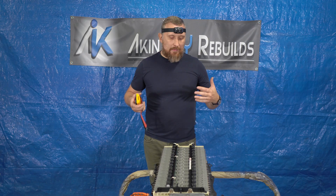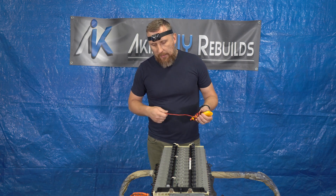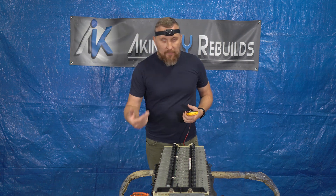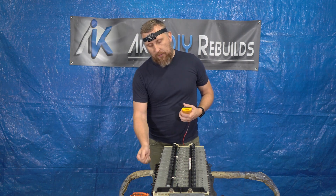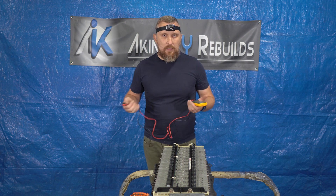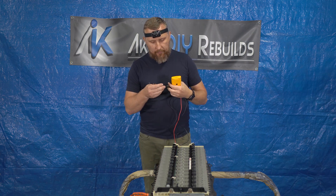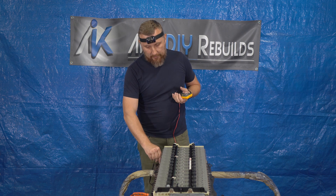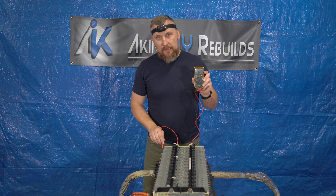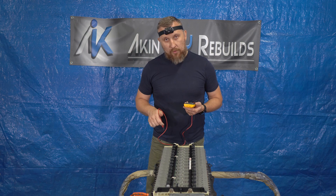Now that we've got these cells disconnected from each other, they're pretty much harmless — you don't have to wear gloves. To find which cell is leaking, you can either visually inspect it and see if you see any corrosion on the bottom base of the battery. I prefer the multimeter method — it's the easiest and most reliable method. I'm just going to use an alligator clip, hook it up to the stud at the base of the battery, and with the other probe touch each terminal to see if I get any reading. I'll go all the way around, checking each positive and negative terminal of each battery.